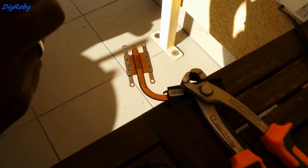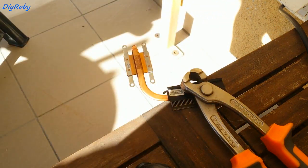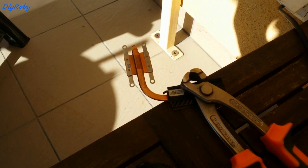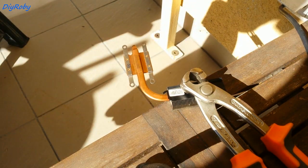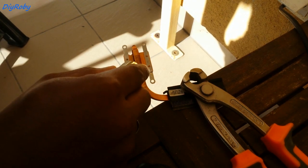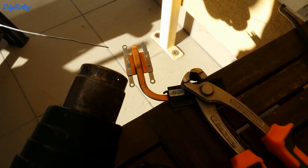Now is the moment of truth. I'm going to try to desolder this heatsink from its shim using a temperature-regulated heat gun. As soon as the heat gun produces enough heat to melt solder, I'll put it on there and see what happens. This may be a bomb, so I'm hiding behind cover hoping nothing goes wrong. First, I'm going to add some flux — this should help the solder dissolve. Solder melted.